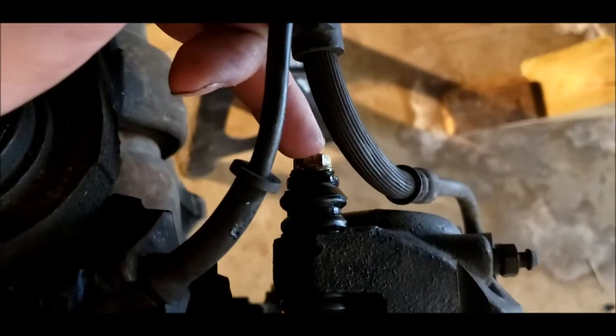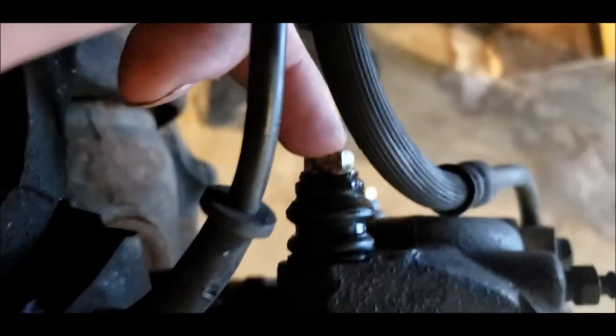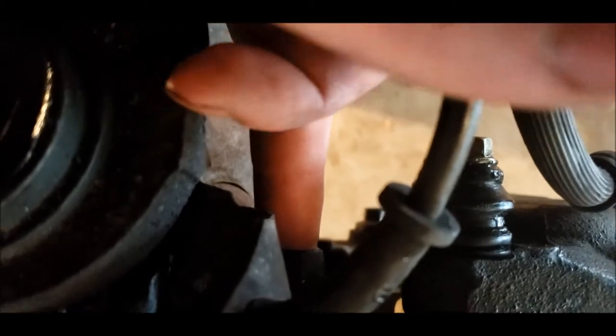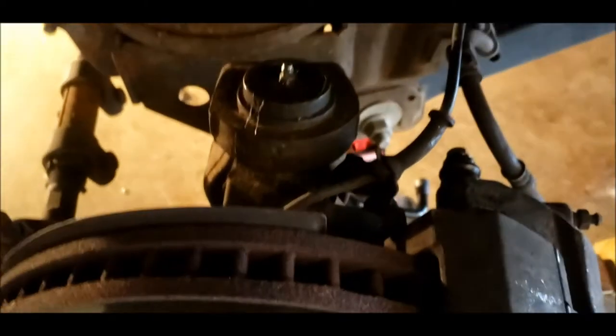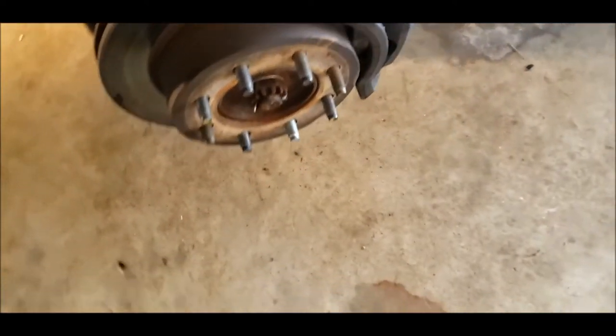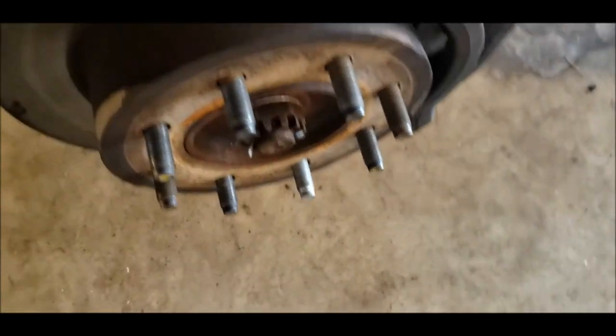Got everything back on. Don't forget, this one torques to 22 foot-pounds, so really that's just tight with a normal-sized wrench. If you took these bracket bolts off, they're like 145 foot-pounds, so get a torque wrench and do those. While you're here, I might recommend topping off your grease. It's also a good time to check your rotor - an easy way to check is watch that gap right between the rotor and the brake pad, watch it for play. I've got a lot of play, but that's because I don't have sockets on the top so the rotor is loose. Put some sockets on to hold it in tight and then you can watch and see if you have a warped rotor.